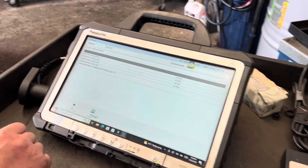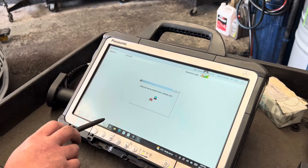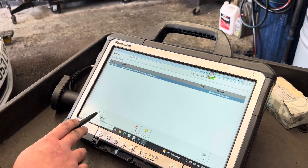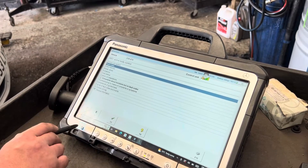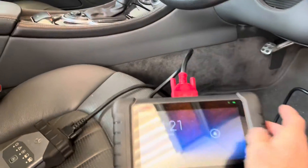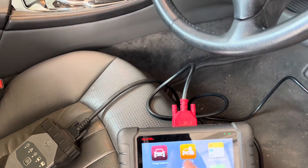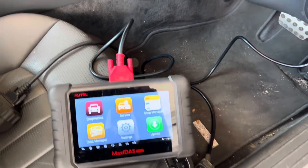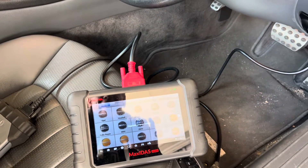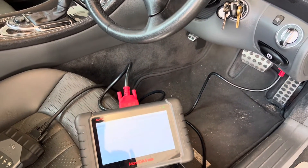Okay, so when the height calibration has been successful and you log back in, all the figures are the same. Every time I'd logged in and it hadn't been successful, those figures were all different. Having fixed the error code at BG Griffiths, they're going to let me plug my Autel system in to see if I can now do a height calibration successfully — in which case the only thing I was doing wrong before was not having it on level ground. If it doesn't work, they'll roll their eyes at me messing about with their SL55.